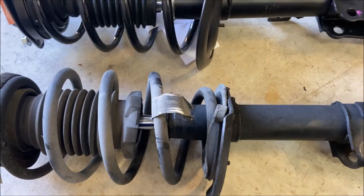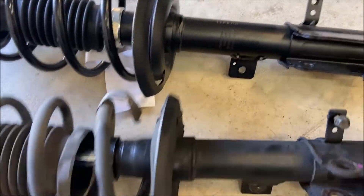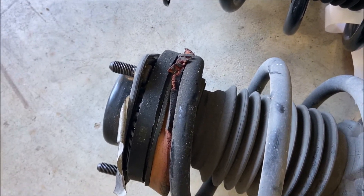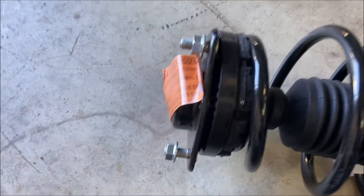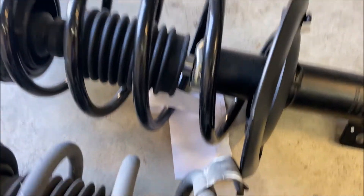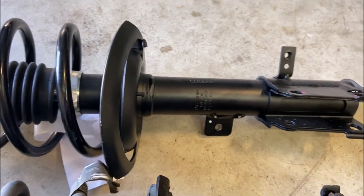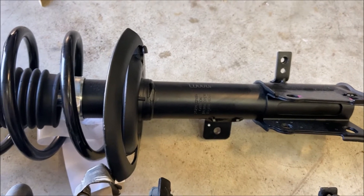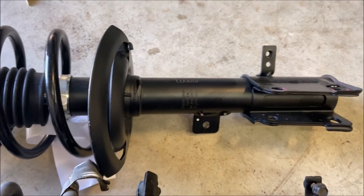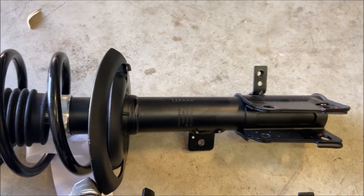Just to give a broader tour of these two parts: they are basically identical, which is great. The old one is really chewed up at the spring isolator at the top. The new one comes with a big warning label to not remove that nut on top, and another warning label that says install the top first loosely, then rotate the bottom to get it lined up with the knuckle, because the top part really only goes on one way. The whole bottom part is designed to pivot so you can get it all lined up.